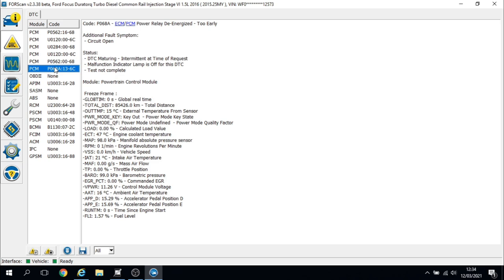It looks like we've got some communication issues, and probably a lot of you know where the problem lies. I'm pretty certain that I do, but not everybody does. So I'm going to confirm whether the alternator is charging or not, and then I think we'll need to get the scope out and see if there are any LIN communication issues. I'll test the charging voltage and amperage, then scope the LIN.